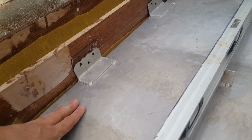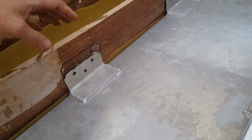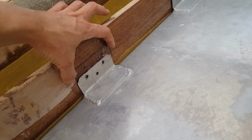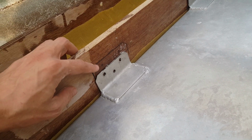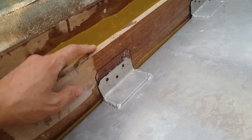So what we're going to do next is we are going to go get a piece of Douglas fir, and we're going to put that Douglas fir directly behind it. I got to measure that. I believe that is going to be wider than a 3.5 inch 2x4. So we'll have to go check it. I've got some 2x6. Maybe we'll put behind it as well.